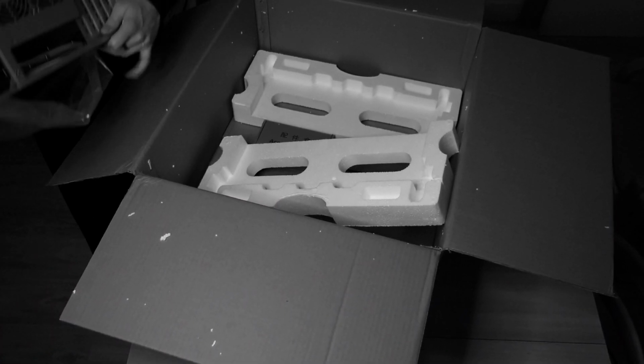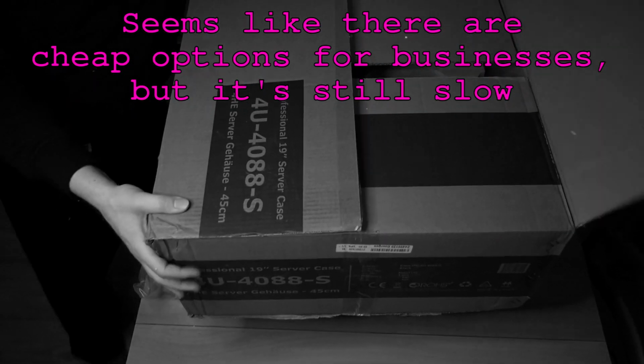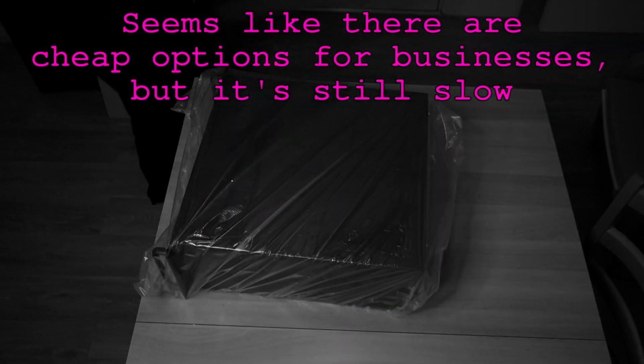First, let's talk about why I chose to build a file storage server. The options were cloud storage, adding disks to my rig, buying a NAS, or building a file server. Cloud storage cost will quickly add up if you have a lot of data to store, and it is slower than the other options. Adding disks to my rig is the fastest and cheapest option, but I wanted redundancy, and there was not enough space for that in my rig.